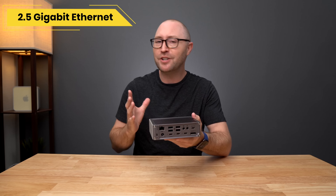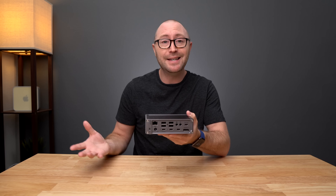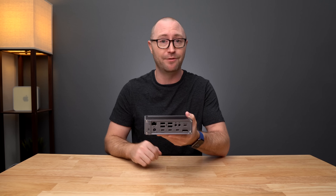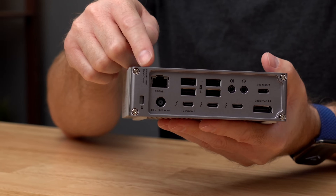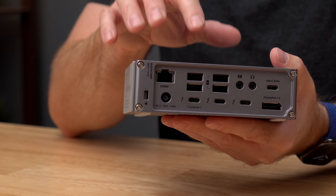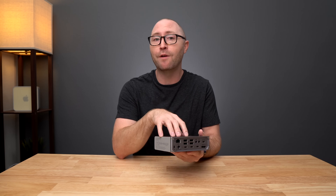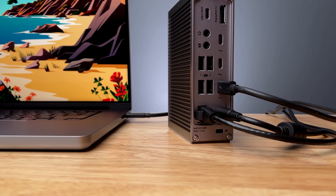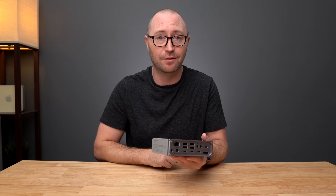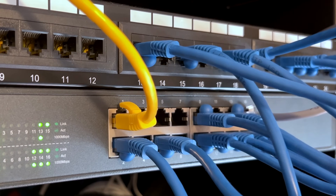Next, let's talk about the ethernet port. As mentioned earlier, the TS4 has a 2.5 gigabit ethernet port. It provides 2.5 times the performance of standard 1 gigabit ethernet. 1 gigabit ethernet has been around for a long time, and many network and router manufacturers have decided that 2.5 gigabit ethernet is the new standard moving forward. There has been 10 gigabit ethernet for some time, but it is really intended for higher end users because of its higher price point. The 2.5 gigabit ethernet port is becoming widely available on routers, switches, and NAS devices. The most common scenario is to connect your Thunderbolt dock to your router's ethernet port for wired internet, and if your router supports 2.5 gigabits or above you will benefit from faster performance. The 2.5 gigabit ethernet port is also backwards compatible with 1 gigabit ethernet and forward compatible with 5 and 10 gigabit devices. So if you are working in an office network environment, it should be relatively easy to upgrade your existing infrastructure to 2.5 gigabit ethernet by just upgrading your existing switch.